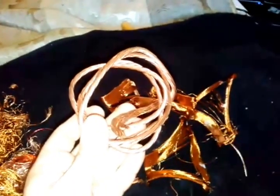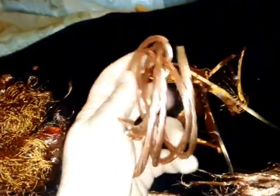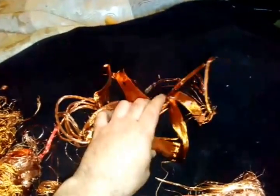This right here is also a really nice piece of copper — it comes out of the back of the TV. You're going to see a very thick wire that encircles the tube. So if you open up any old-school monitor or any old TV, not the flat screens but the older type, you're going to find a wire that goes around the tube, enveloped in a kind of thick tape. What you want to do is carefully remove that wire, strip it open with wire strippers or scissors, and you're going to get this very thick-looking piece of copper. This weighs a few pounds, believe it or not, so this piece alone could be about ten bucks. It does add up, so if you see anybody throwing away a TV or an old computer monitor, if you can get five or ten for free that's even better.